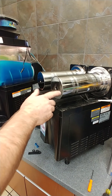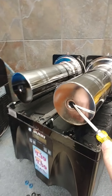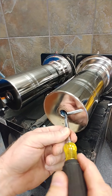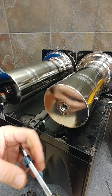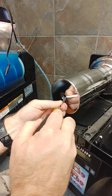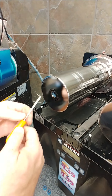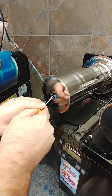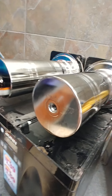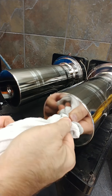Now since we have the motor and the drive shaft out, we have to replace the front drive shaft seals. Take a screwdriver, put it in behind the edge of the seal, and just pop it out. Also inside here is the shaft bushing — slide that out of there. Do the same on the other barrel: pull the seal out, pull the bushing out. If the bushing is being difficult, take a seal tool remover and pull it out. Then it's a good idea to wipe out the surface where the shaft seal goes on both sides.